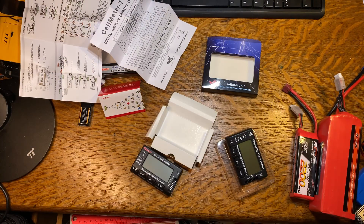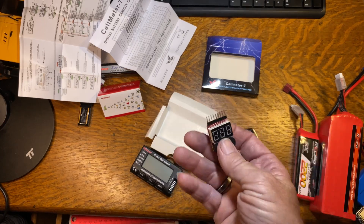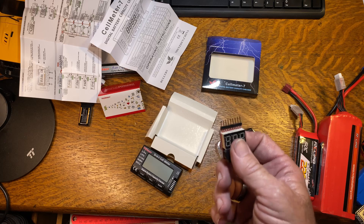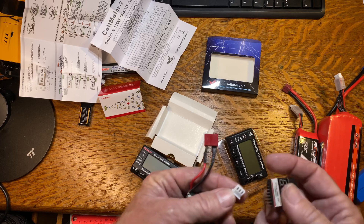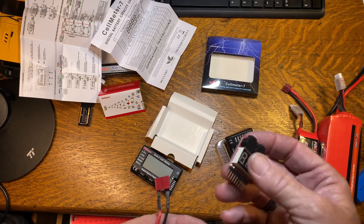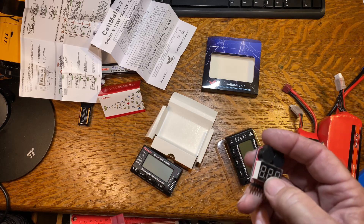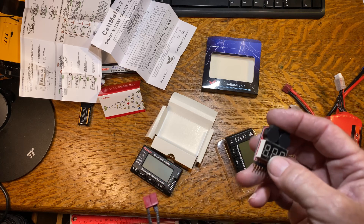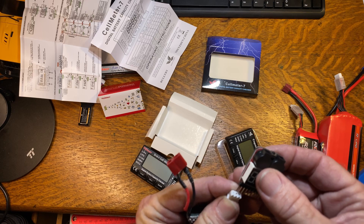So now what we're gonna do here — I've got my lipo alarms, and I need to show you guys for the newer people in RC how these things work one day. It is an alarm that goes on your vehicle. You can run this on the car, boat, plane, whatever. You can set the voltage minimum on this, and if the voltage gets too low, these beepers will beep. And they're pretty loud, so I'm going to shut up so I can turn this down.